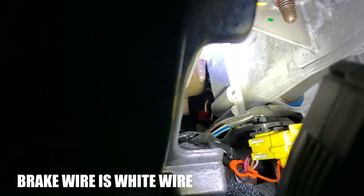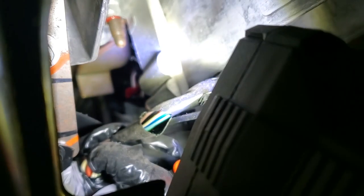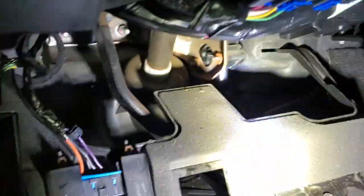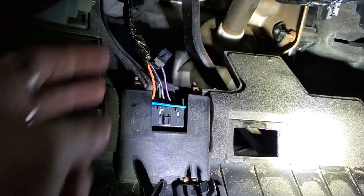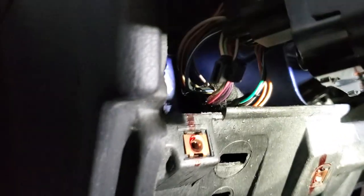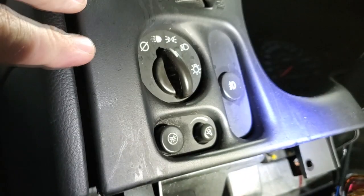Right back there — it's kind of hard to see — there's a red T-tap on the white wire coming out of the brake pedal. That red T-tap back there on the white wire is the brake pedal. Down here on the OBD-2, this is your data wire, which is a purple wire. We did a black T-tap on it because it is a very thin data wire — I would not suggest using anything but a black T-tap. If you want the parking wire, it's right behind here, tapped with a black T-tap. It is a gray with a black stripe, so if you do want to tap the parking lines, that's where they are located.